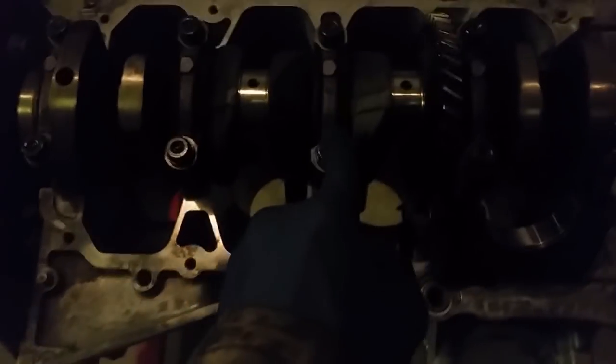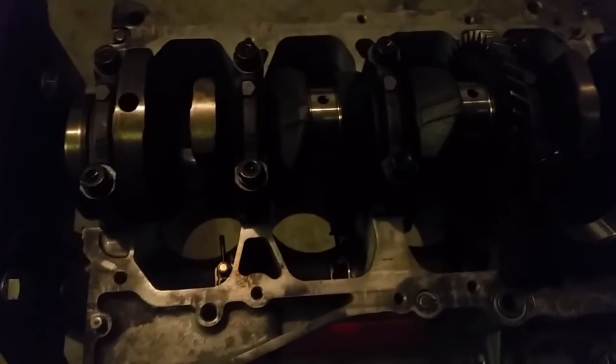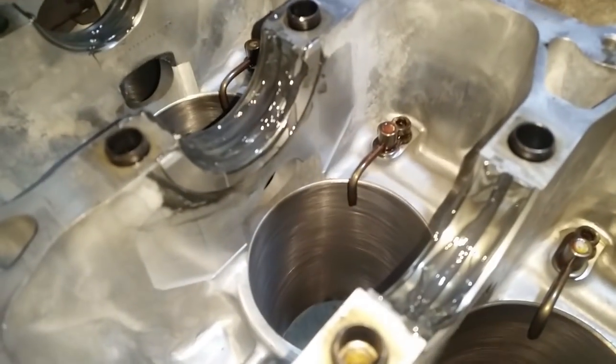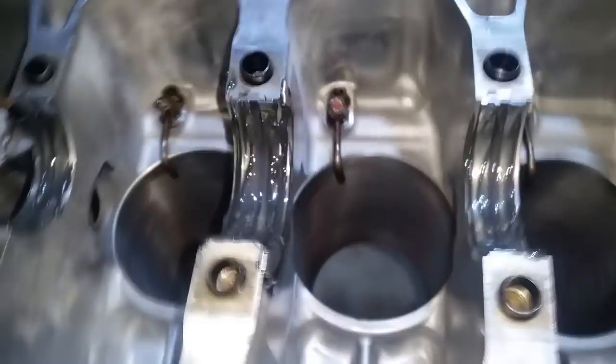After this, I will take off the crank, recharge my battery, and then go ahead with the installation of the thrust washers and everything else. At this point, I have installed the thrust washers on both ends. These are floating thrust washers. Make sure you have the beveled ends facing out on both sides.